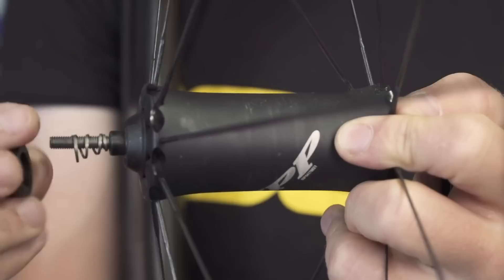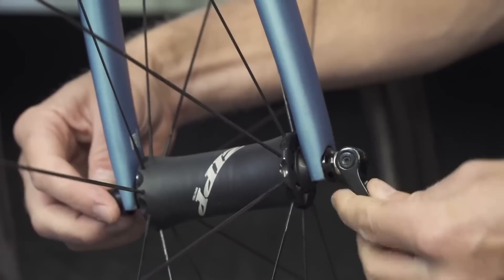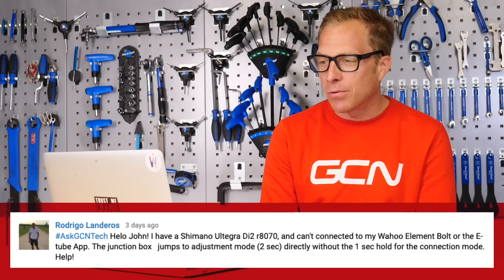David, you aren't going to like this because I would say go for the heavier steel skewers. The reason being, like you say, titanium does tend to stretch. In fact, when titanium bolts are used in the automotive or aeronautical industry, once fitted and removed you generally can't reuse them because they've stretched and won't give the same fitting. On a bike we're not putting through quite the same stresses, but they do stretch and tend to click — titanium bikes in the early days always seemed to make annoying little clicking noises. You've already lubricated the shaft and nut, which I'd have thought would get rid of it if there were any issues there. You could also try the axle-to-dropout interface to stop that clicking. But personally I'd go back to heavier steel skewers — you don't have to tighten them up quite as much, avoiding that fear of stripping the thread on a hundred-pound pair of skewers. Sorry, you're going to have to go for the heavier ones in my honest opinion.